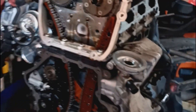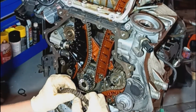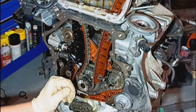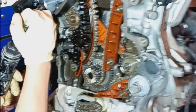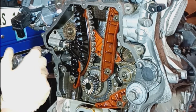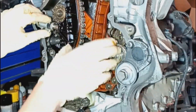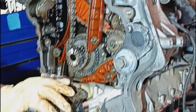On the first and second gen, you can just lift the chain off the gear. On a third gen, it has one less tooth, so you have to pull everything off and then pull the cog off to get the oil pump chain off. We got lucky with this being a first gen — on the third gen it's one more thing you have to do.